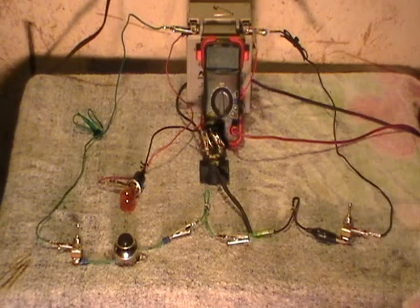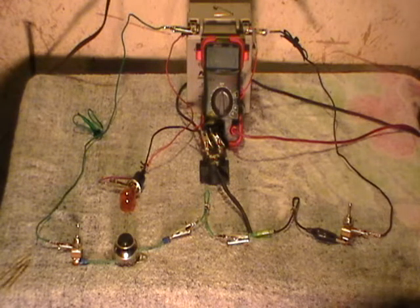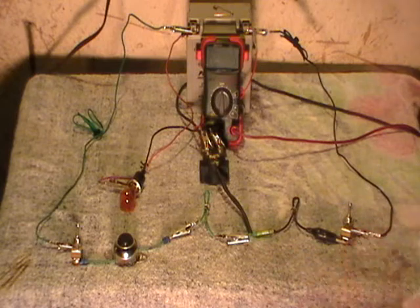Before I do any type of electrical diagnostic or tracing, I want to get an understanding of what I'm working on. I'll look at some type of roadmap — for electricals, that's in the form of wiring schematics. We actually have this available for free in the forums under the garage section — I think it's around page 100. It has a really good complete view of the directions and paths the wires take, wire colors, and the switches they go through. I strongly encourage all members dealing with electrical issues to review the wiring schematic. There are also troubleshooting charts and value charts that can really alleviate a lot of headaches and fix your bike quickly.